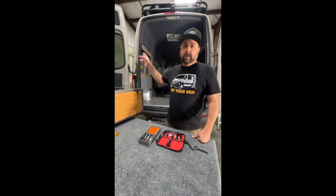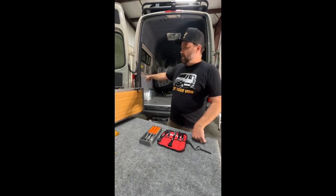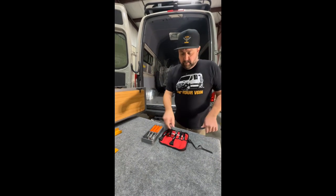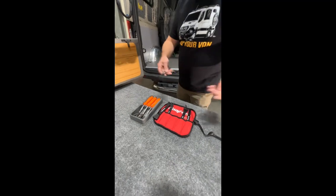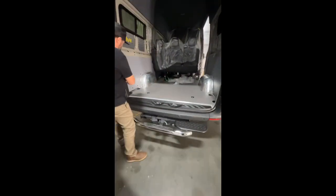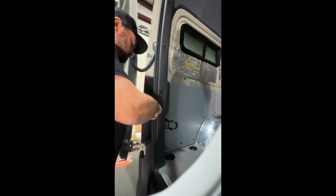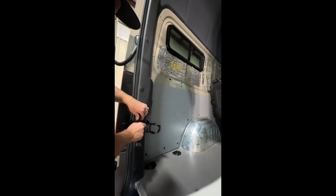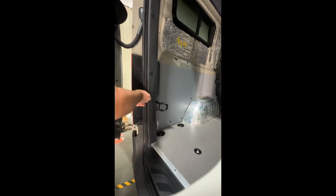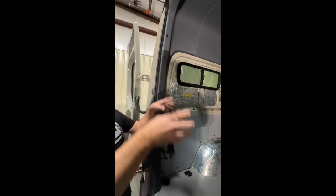We now have all the holes pre-drilled in the headliner through the back for where we're going to mount the cabinet. What we're going to do now is remove the headliner starting with the pillar body cladding. On the plastic, we like to use these plastic body clip removal tools — metal ones are available too, but you can buy these at a hardware store. You'll need to get underneath these body clips and work them out. This is a two-stage clip so it might take a little prying — pop the outer cap, then pop that, and work your way all the way up. Remove the cladding and then we'll show you how to remove the headliner.